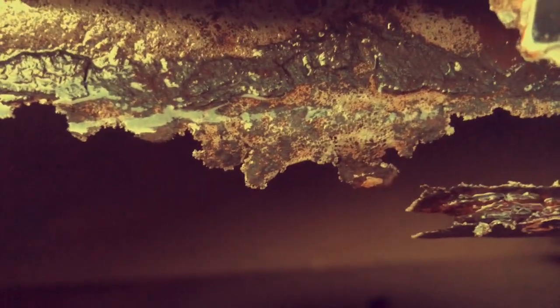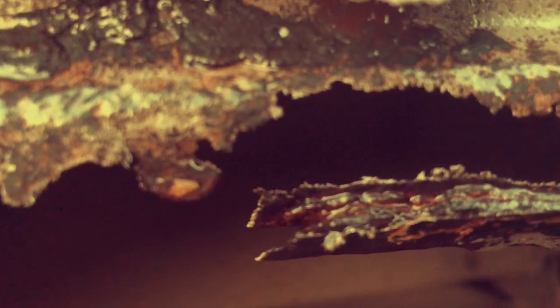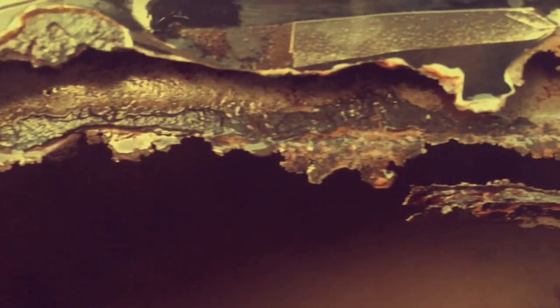I've just soaked this piece in vinegar — you can see it. Watch, it's going to turn black. See how it's turning black and gold now? That's not rust — that's neutralized rust. See the color changing? It's eating the rust out of the pores and leaving the metal neutral. This is doing the same thing as your rust-converter primers and all that. The only thing it's not doing is impregnating it with zinc.